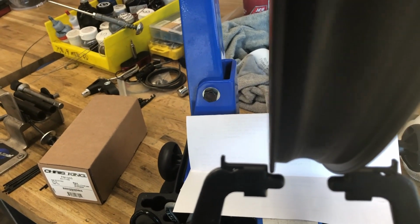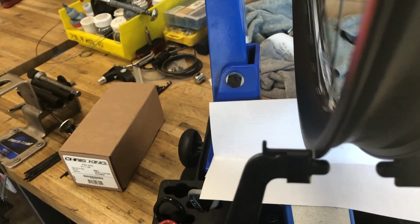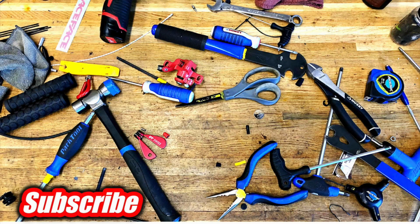One thing to keep in mind, once you put the tire on and get it inflated, the tension's going to go down a little more. Once I get the tire on and inflate it and check it, I'll maybe touch up the lateral just a little bit. Typically, I won't really use the little tension gauge at this point.